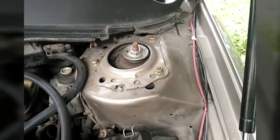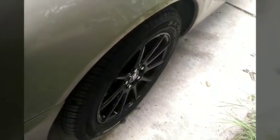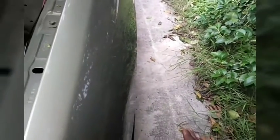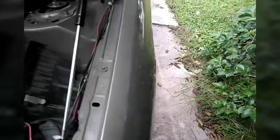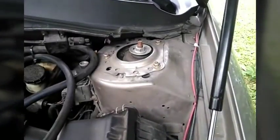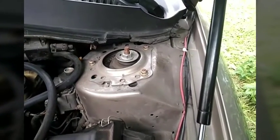And that got the wheels in spec — they were both the same on both sides. So basically it was two degrees with the camber plates and another extra degree by moving the plate. That's how I got it into spec. There's no negative camber, as you can see right here — it's right in spec. Now let's go under the back and see how I did the alignment and the camber in the back.